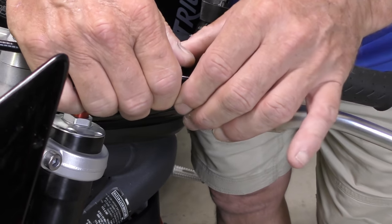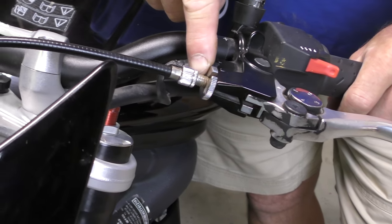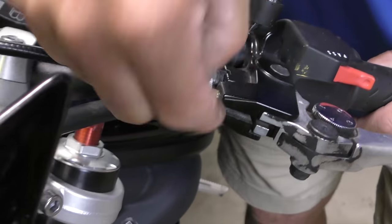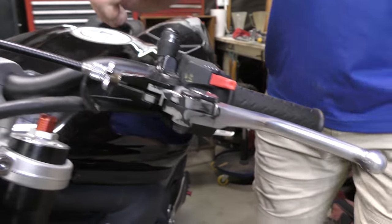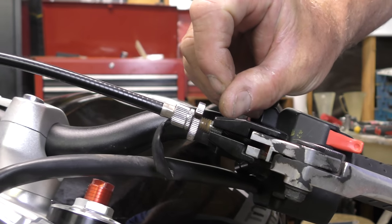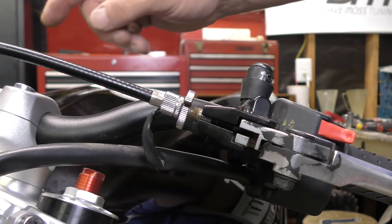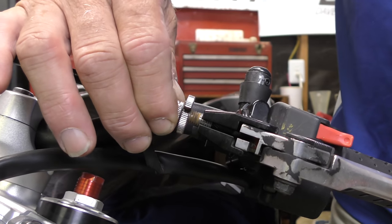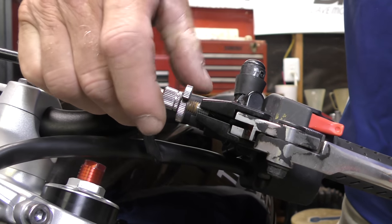At this point that's nice and snug. Now we also have to look at how much of our adjuster is sticking out — and that's quite a bit. If there's not a whole lot of adjuster thread remaining on the other end, there's no point having two-thirds of the adjuster sticking out past the perch. If it gets too loose and wobbles, you'll break it when you shift and then you're stranded.